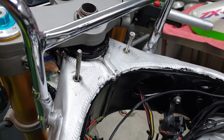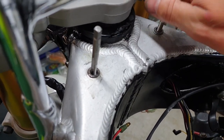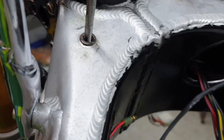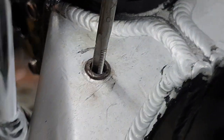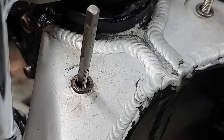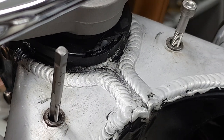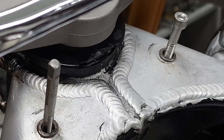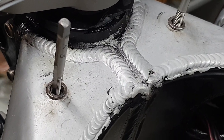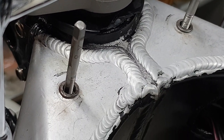First hurdle I've hit fitting the fuel tank. Basically, this fella here, I was able to tap it out. The bolt goes in and out. This guy here, it's thinking about turning the insert, the threaded insert. So the game plan: I'm going to repair the thread, and fingers crossed I'll be able to screw a stud into that, which I'll cross drill and put R clips in, so I don't have to keep pulling them in and out, because that's sort of playing with fire, going much further trying to wind a bolt in and out of it. So that's my plan.